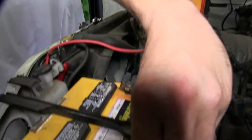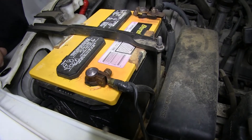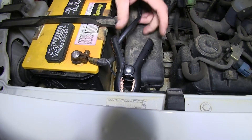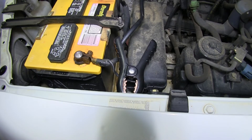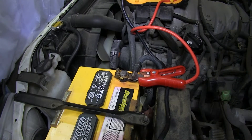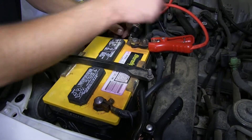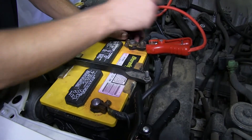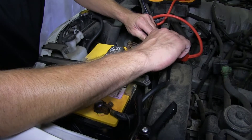To do this, we'll plug the black wire onto the negative battery cable as we remove it from the battery, or a ground of the vehicle, as seen here on the fender. And then the red clamp will route to the positive battery terminal, or cable, as we remove it from the battery. This will allow us to keep current of the vehicle, so we don't lose any of the preset stations of our radio or computer-controlled systems.